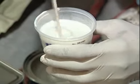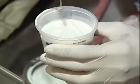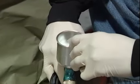The larger the nozzle, the more even the spray pattern on the vehicle surface. But for what we're doing, the evenness doesn't play a part right now. And this is the viscosity, for me, about a half a second in between each drop. I think we're ready to go now. I'm going to load it into the gun right now.